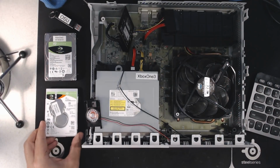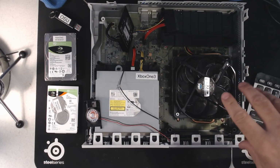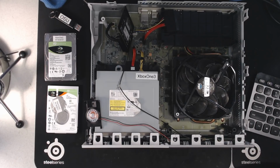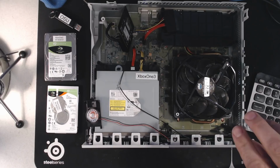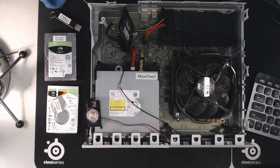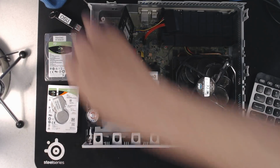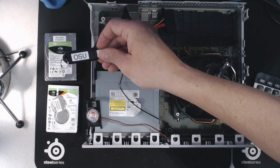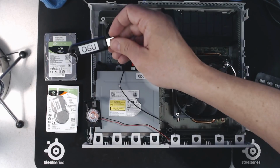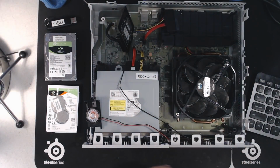Now, this is a process that I've been doing a lot over the years. With this particular video being my latest version of repairing or replacing your Xbox One hard drive, this is the streamlined process that I've been using over the last few months that I think will be the most straightforward process for people to use. Aside from a replacement or new drive, or a drive that you're going to be repairing, you'll also need a USB flash drive with OSU1 copied to it. I have a video specifically about creating an OSU1 flash drive, and I'll link that here and in the description of this video. So let's get started here.